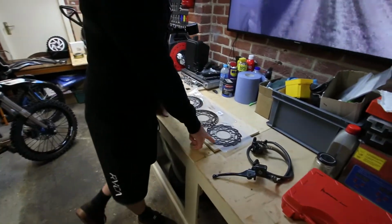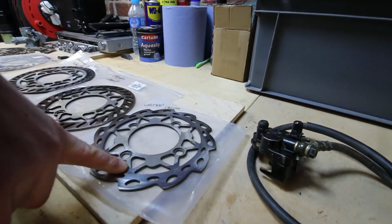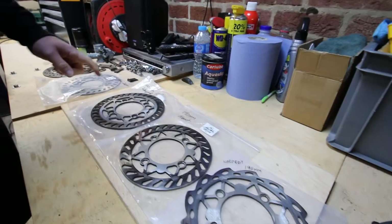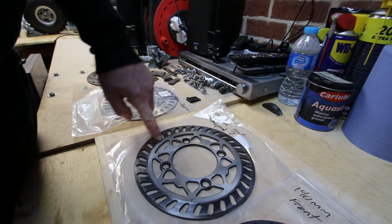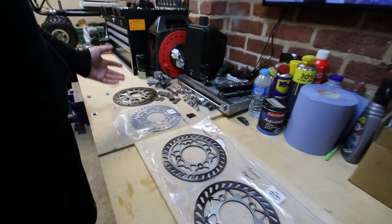You can see sometimes this pad's been wearing too far down, it's been wearing on the supports. Likewise on that one, these discs are actually warped. And then on that disc, it's not big enough, so there's a portion of the disc that's not even being used, so you can see where the brake pad is rubbing. So there's a few things on there.